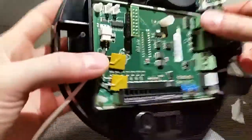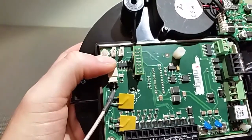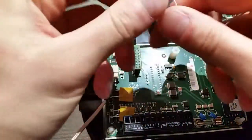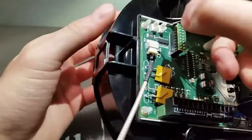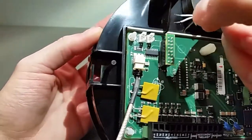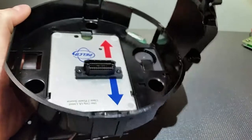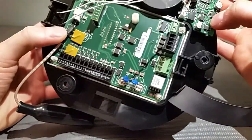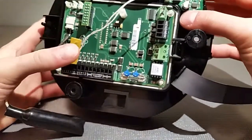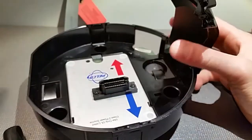So that's pretty much it. It goes into heater control. Since I do not have that little two-pin connector, I'll have to find one in my spare parts. If not, you can just cut that off and solder right onto the pins with heat shrink tubing, or take that connector right off and solder right into the board. The actual thermostat itself is in here. The blower runs continuously 24/7 and the heater only kicks on when the temperature drops below a certain temperature. You're probably going to want to power it up, test it, maybe stick it in the freezer and see if you can trigger the thermostat and see if it comes on. Pop it back in the housing and you're good to go.